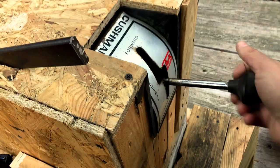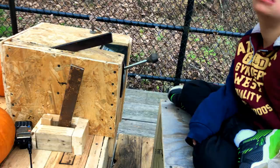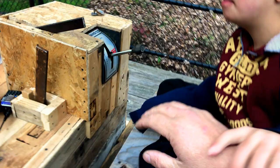These are the old Cushman golf cart controls — forward, reverse. The speed controller is under here, using resistive speed control. This is the throttle. There are four speeds no matter what voltage you've got: low, slightly faster than slow, medium, and full speed — no speed restrictions whatsoever.